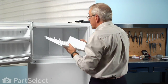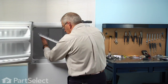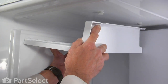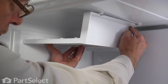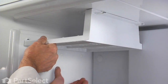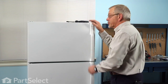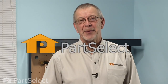We'll put the shelf back in for the ice cube trays. The two pins need to go into the upper portion of the slotted hole so the shelf sits tight against the wall. Hook the two slots on the top into the T-pins, then pull those two pins out and set them down into the bottom of the slotted holes. Now we're ready to load the freezer back up, plug the refrigerator in, and our repair is complete. I told you it was an easy job — thanks for watching, and good luck with your repair.